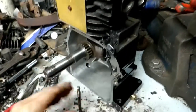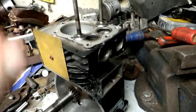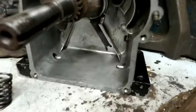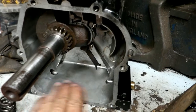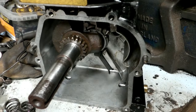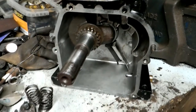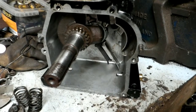I'm sure there's some professional way of doing it with a surface grinder, but I don't have access to anything like that. These old lads don't run long enough that it's going to matter much anyway. I do the best I can — I clean the block right out with Varsal, and you get a lot of gray scunge in the bottom. It's probably worn aluminum from the block, and just stuff from years of running, sand or whatever gets in there. Since they don't have an oil filter, it all builds up in the bottom of the crankcase.